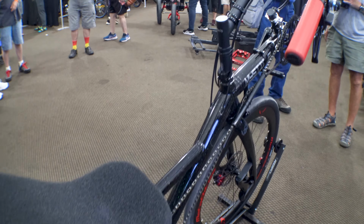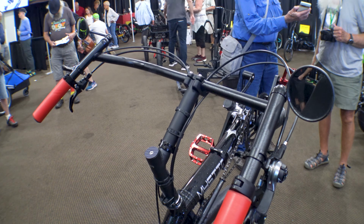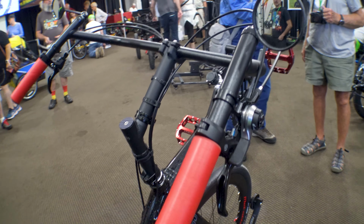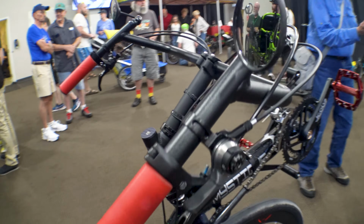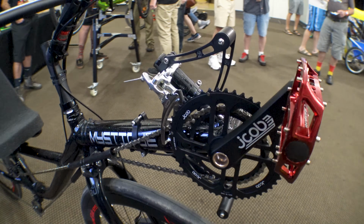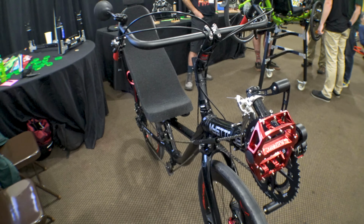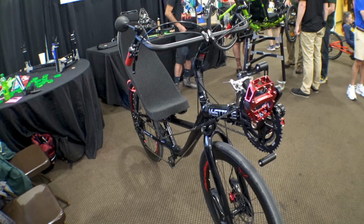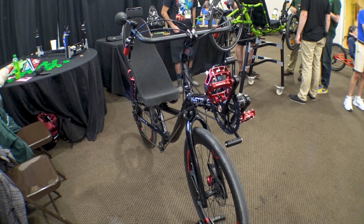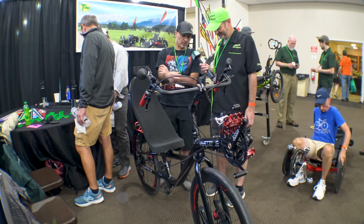The next thing is I designed it so that it had a real firm ride up and down, so to speak, so the power gets to the ground, but it's smooth all around. One way we achieve that is having the rider's head, even if he lays back, ahead of the rear axle. So all those little things add up to a very smooth ride. Also, I spent a lot of time on the front end, getting the front end to the minimum height we could and still have clearance for even the big tires and heel clearance. So there was a lot of thought put into it.